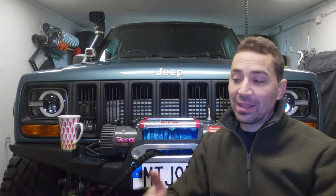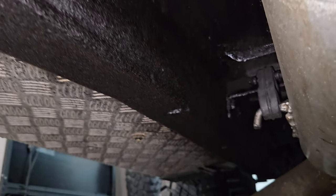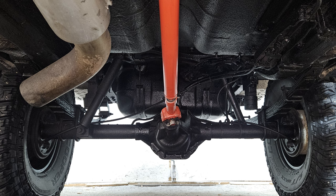If it's somewhere inside like on a floor pan, you can bed-line over the top of it afterwards and you're done. If you look under mine, I've recently replenished the undercoat on this Cherokee and I tend to do it pretty thoroughly every five years. When I first bought the Cherokee, the first three years of its life was me underneath it with grinders, wire wheels, and shot blasting - everything I could to clean up the underside and get it in as good a position as I was happy with.